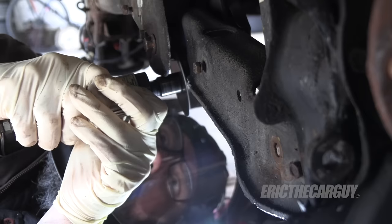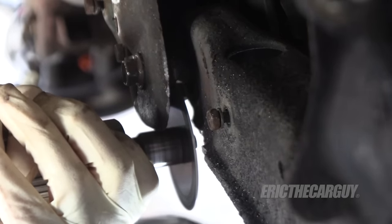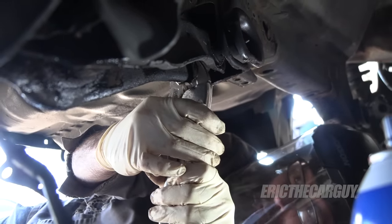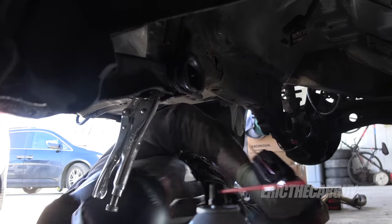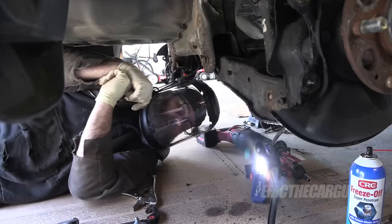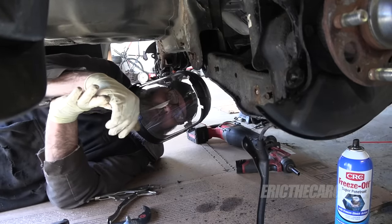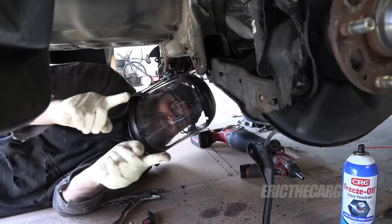It's never gonna work. Take that. We need to tie the caliper up and we can take the strut out and the lower control arm, and it all should drop down. And then we can mess with the rest of the stuff — and not lay on the ground. For this side. Still gotta do the other side. It's not that bad.